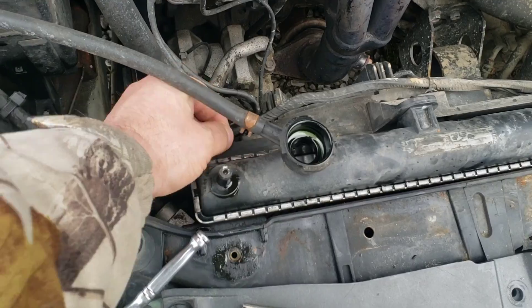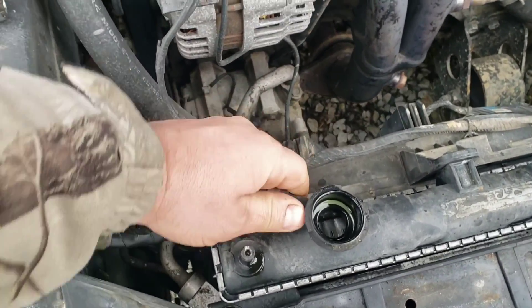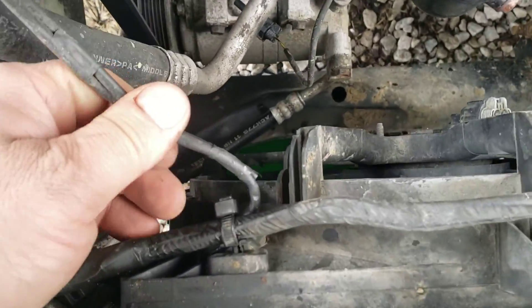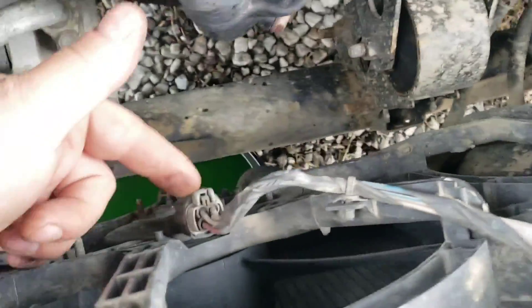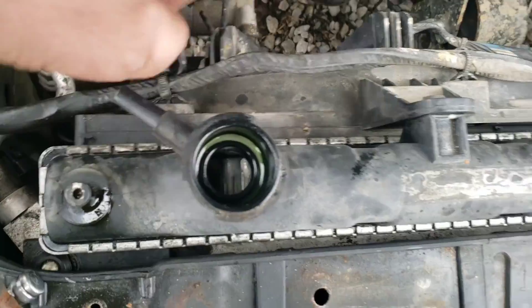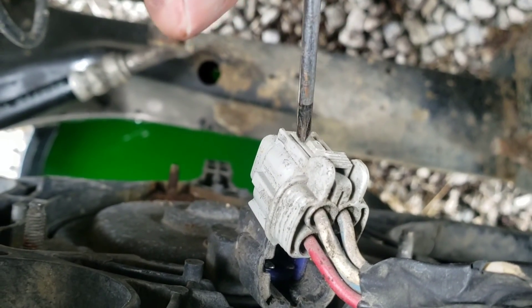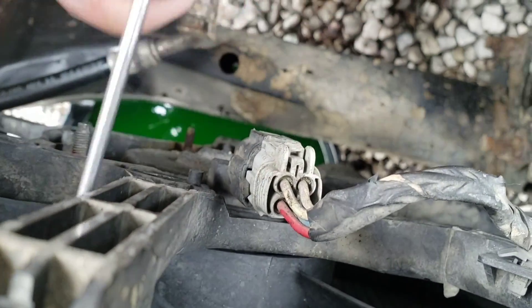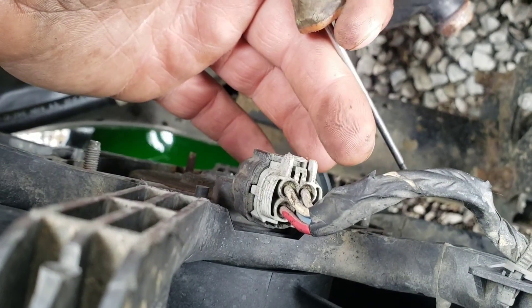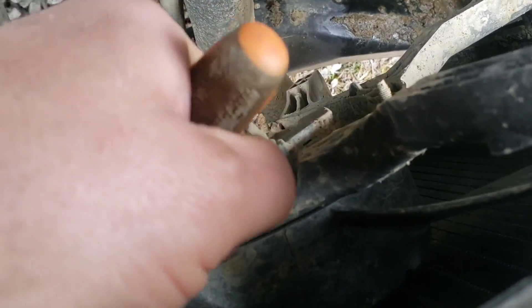You're going to have to move this out of your way. Mine just broke — it might be the same situation with these where it's really seized on. You're going to need to unplug where the fan's plugged in — you've got one here and one here, and it's mounted here. You're going to have to cut or pop this off to pull the wiring harness out of the way. You press down on this gray button right here, that'll depress the entire thing, it clears that lock tab, and then you'll be able to pull it out. It's probably going to stick — try not to pull on these wires.